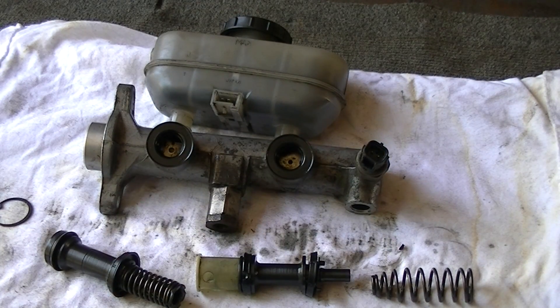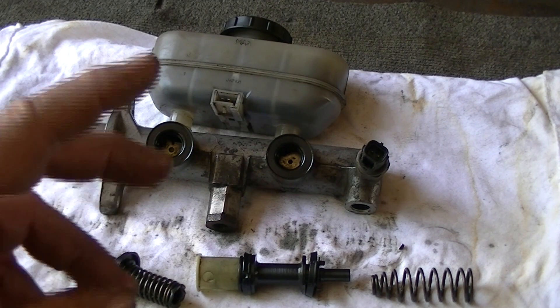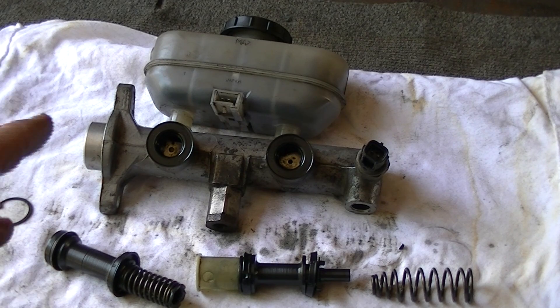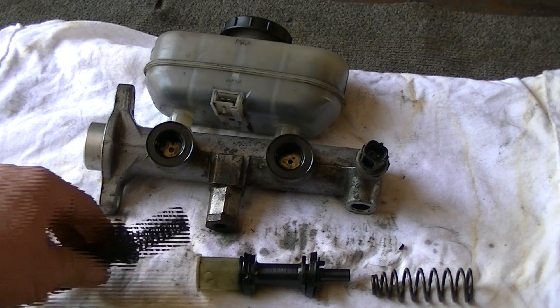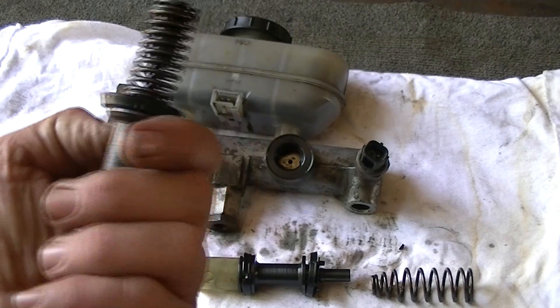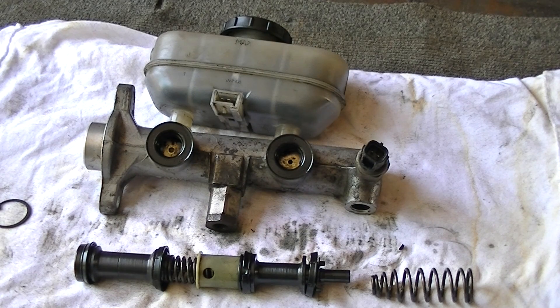Alright guys, that's it. Thanks for watching and good luck. If you have a braking problem going to the floor without ABS, it's more likely your master cylinder. If you have ABS, then it gets a little tricky — ABS systems can go bad and you'll still have a sinking pedal. Usually when I have a sinking pedal with ABS or even a bad master cylinder, I still don't get a brake warning light 99% of the time. You basically have to do a process of elimination, tear your master cylinder apart, physically look inside and see if there's a bad seal, and if it is, go buy another master cylinder. Thanks for watching guys, enough rambling on and I will see you later on my next project.